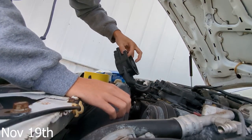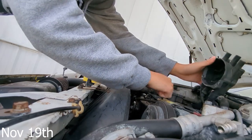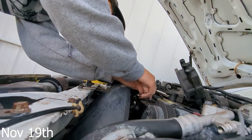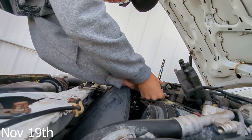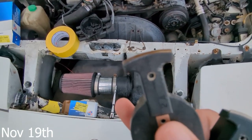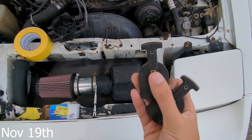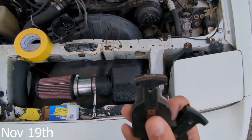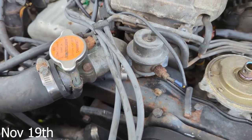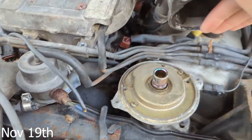I've got this half of the coils on the new distributor cap. I'm going to leave the other coils on the old side just so I know where they go until I get the rotor changed, then I'll switch over those other ones. Just wanted to show you guys — this is the old rotor. It's a bit corroded, real brown compared to the new one, which is nice and shiny. The crank angle sensor I believe is under these two Phillips head screws, and then I can change that.